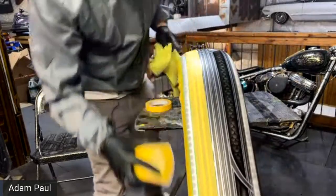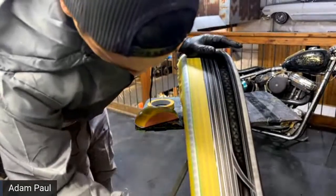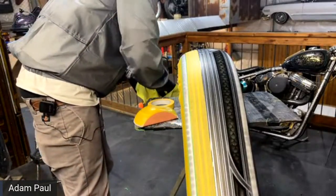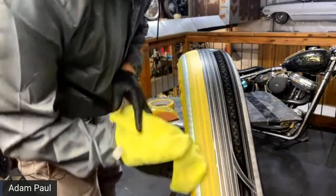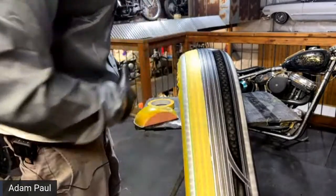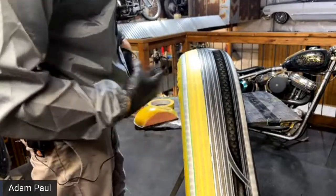What he's asking is, sometimes your clear coat, sometimes your paint candies only stay open for so long. And when I say open, that means the next layer won't stick if the base layer's been on there for so long that it's kind of sealed up. So what you would do is throw a little bit of intercoat clear in your gun and spray it over the top, basically re-wetting and rebinding the base coats with that.